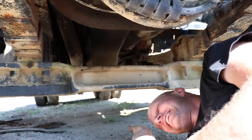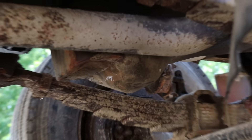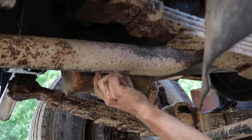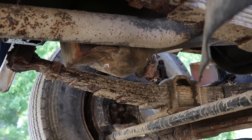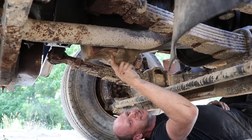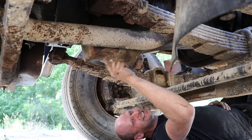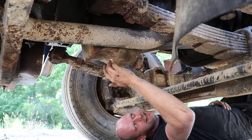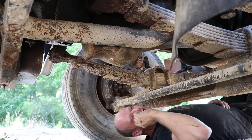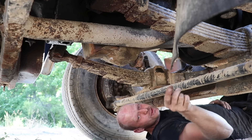Whoa! I'm looking at you James, because I see some shiny marks here, and some marks here that kind of look like forks. I could have blown up this engine — I had oil pressure, I could fire it up again to prove it. But this oil pan is punched in. What that does is push up against the strainer, blocking it from picking up the oil. I could have damaged — I could have blown this engine up. But I could have also rebuilt it in a weekend.